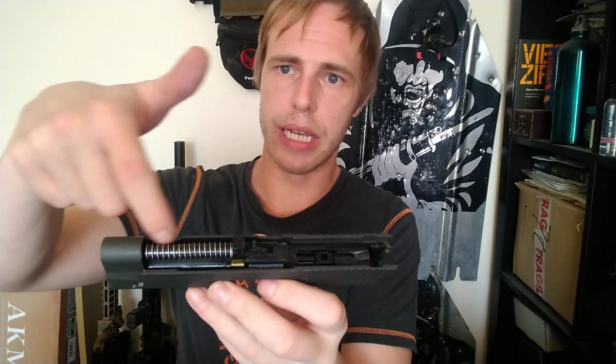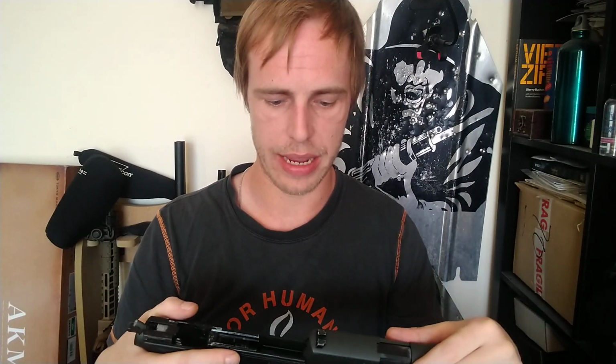So you essentially go down the runners on the inside here and here. Also clean the runners down here and down here, and just wipe off any dirt that's on there, and just re-lube it. Just spray it again with some silicone spray, and you will go back to full and normal functionality. Now, it was a little bit more sticky when I originally took it out.